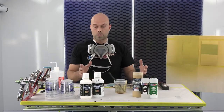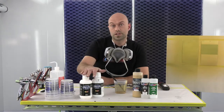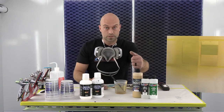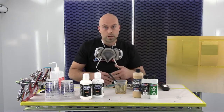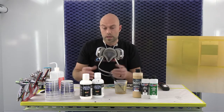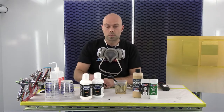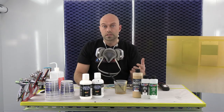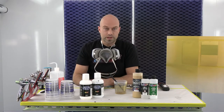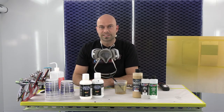So to recap: we used sealer tan and sealer yellow to create the ground coat for the gold — in this case the metallic gold, but it works well for pearl gold or any gold color throughout our whole line. It's a simple way to keep everything consistent and achieve that nice, perfect finish. Hopefully this helps you guys out. Thanks for checking out Base Coat Basics, and we'll see you next time.